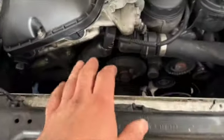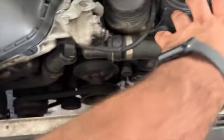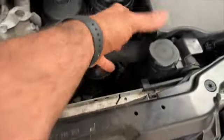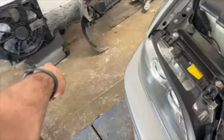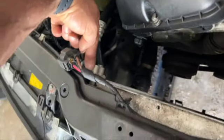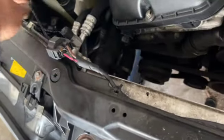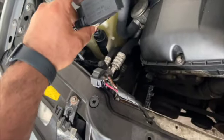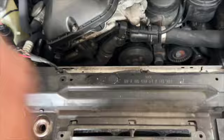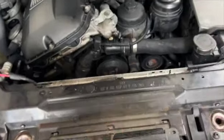To speed this up, I've already removed the air duct — that's three poppers and this little plastic piece, pull that out and put it on the floor. You'll notice the fan is out; there's one T30 screw that goes here, disconnect the fan, and then the fan just pulls up nicely. Got all that out of the way very easily.